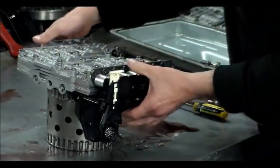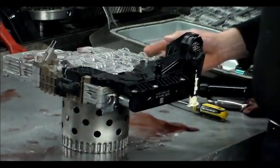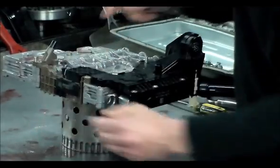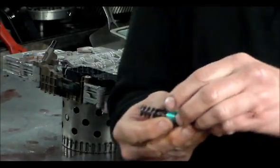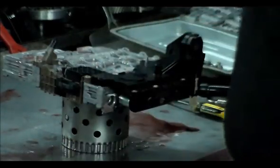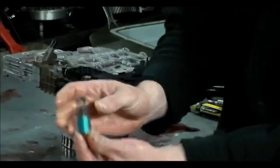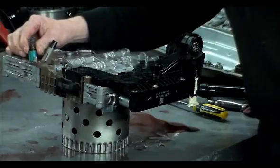I just want to turn this over and tell you one more thing. When you take the bolts out and drop the valve body, here's the input speed sensor and here's the manual valve that works this slide piece. When you drop the valve body out, this is going to fall out — it is the thermal element that goes in the case. It's going to sit up in the case; you'll see the hole. The spring is going to go in first, and then the element, so it goes up in the case just like that.